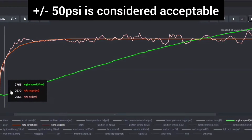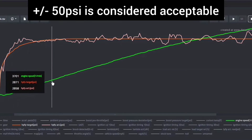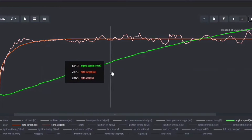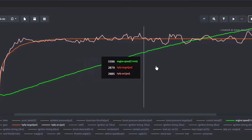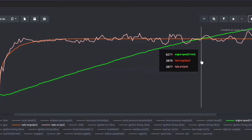And you don't want that to happen because that's something that can cause your car to misfire. It can cause the car to go lean and cause a lot of issues. So that's why you want to make sure you're getting your mix right and then check your logs to make sure that the rail pressure is holding as a good indicator that you got your mix right and it's dialed in for that tune.